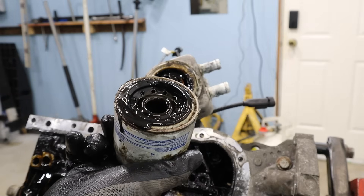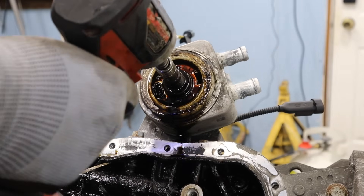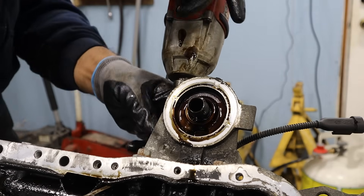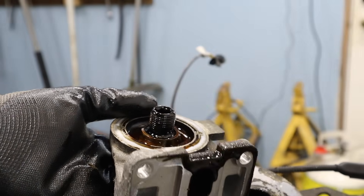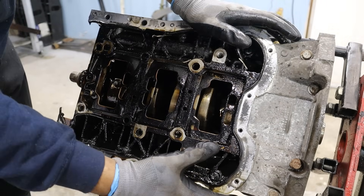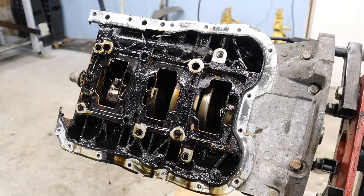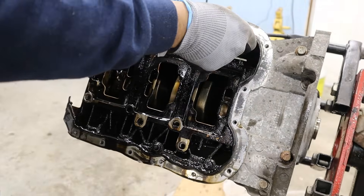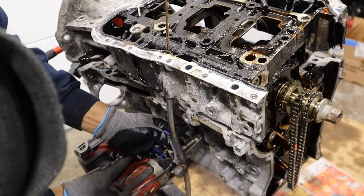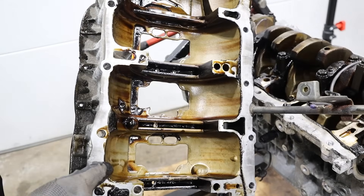The oil cooler is just staring at me, so let's take that off. The oil filter looks terrible — anybody could have opened the oil filter and seen how bad it was. To get the oil cooler off it's a 12mm hex, with cooling in, cooling out, and oil in and oil out ports. The filter housing is held on by 12mm — very simple, oil in, oil out, straight to the filter. Now let's get the lower oil pan off — it's not only a pan but a ladder frame structure that strengthens up the bottom end, which is especially important on the turbocharged engines. I've stripped everything down to the block and crank and I still can't get this thing to rotate.